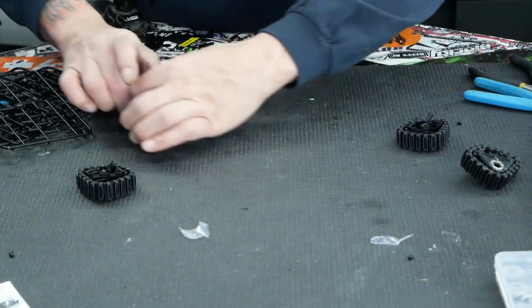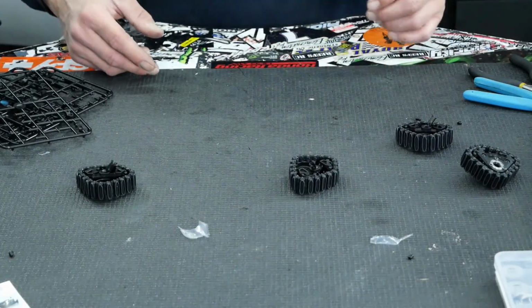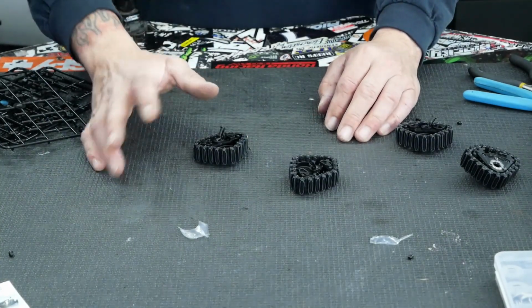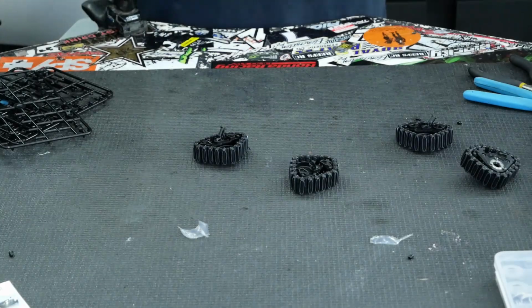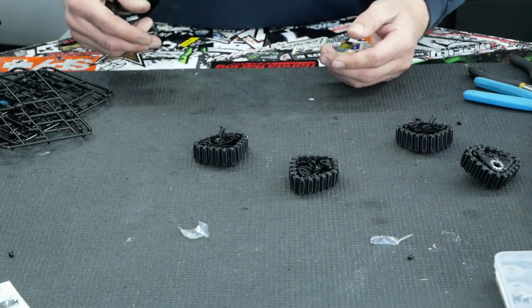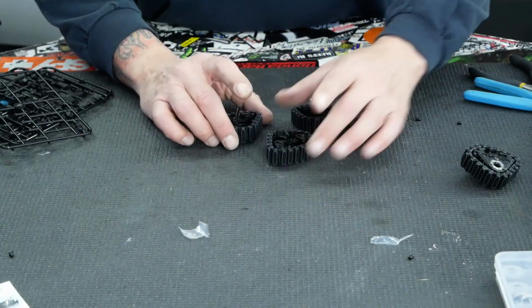Yeah, break them in. The key thing is breaking them in. Don't make the truck do it because it's going to fry up the motor. It's going to be chunky. I see a lot of guys building them in their videos, slapping them on the truck, and then when they drive, you can see them catching, and then they have to hammer the throttle, and then it only goes under full load. It's not good. You should crawl with the tracks on beautifully.